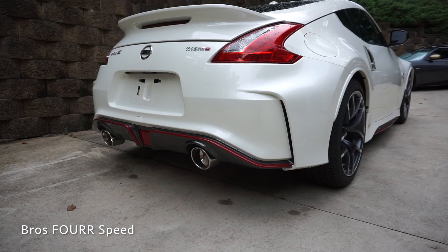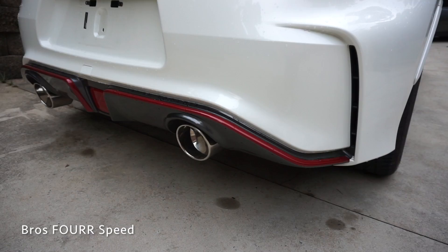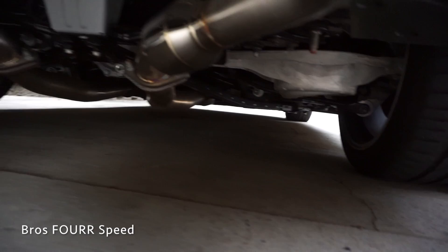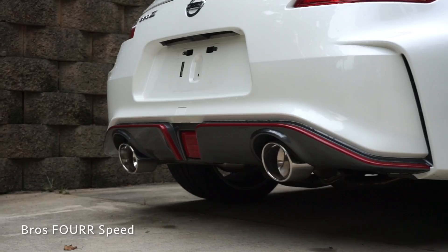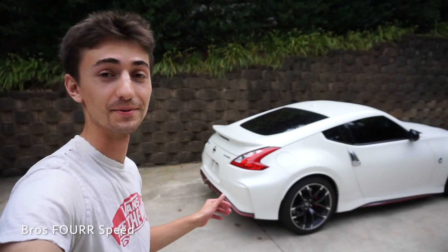Fitment is really good with just a few more adjustments to get them perfect. With the Nismo, I don't need to spend the money on a cat-back exhaust. If you do have the normal Z, you can get the AAM mid-pipe, which will make this a true dual all the way up to the cats. This now has a true dual exhaust, no more restrictive muffler, really good-looking 5-inch tips that are the same size as the Nismo tips — looks good and sounds really awesome.